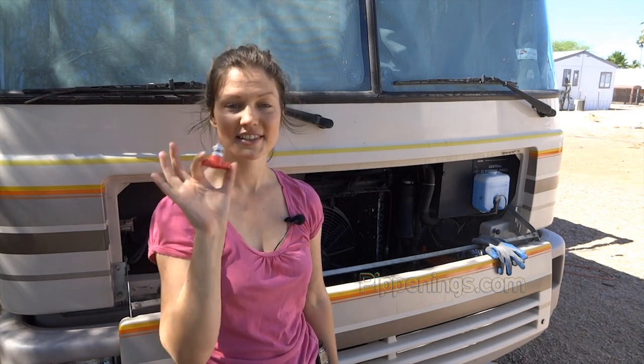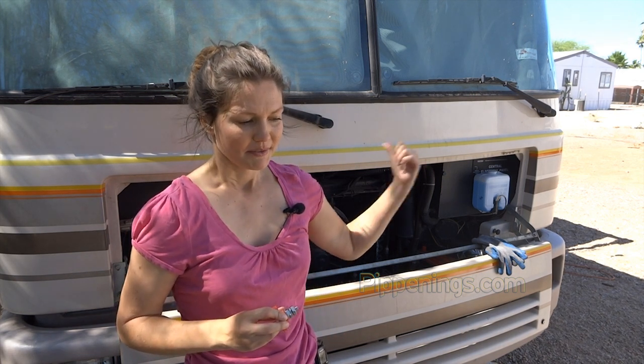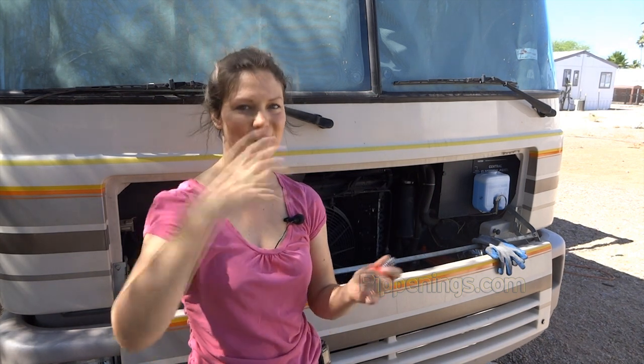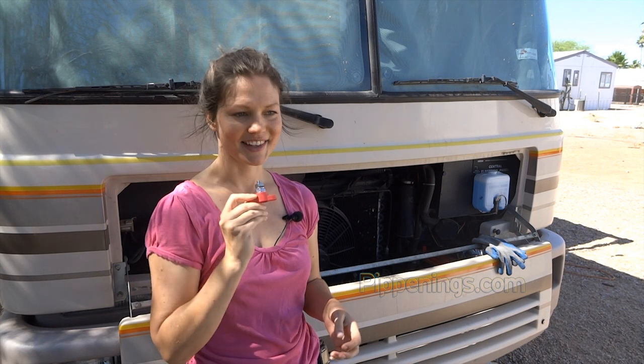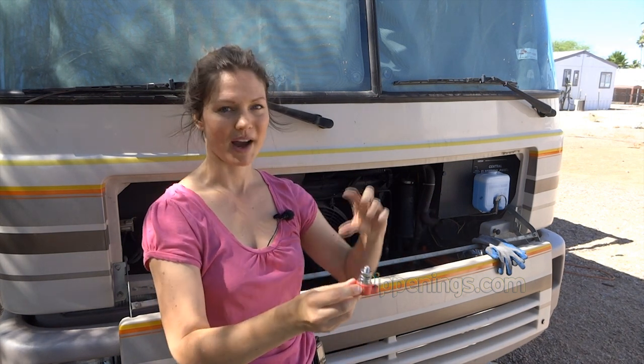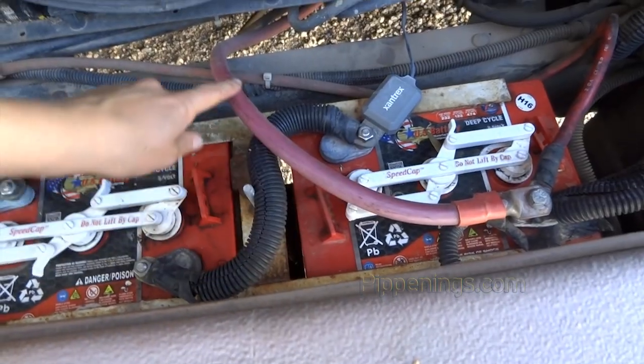This is the same exact thing that I used for my new positive terminal that is outside of the battery box instead of connecting them into the battery. So this is like a separate satellite where others will come and then a big wire will go to this. And that happens to be the big cable that's going from the current batteries to the inverter.